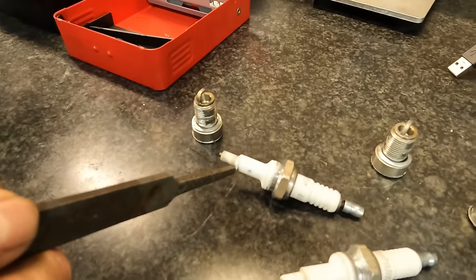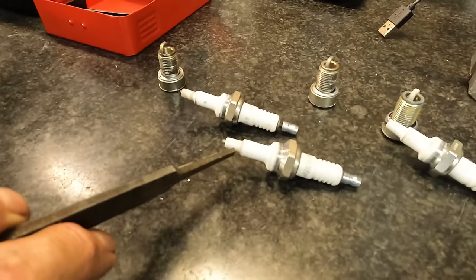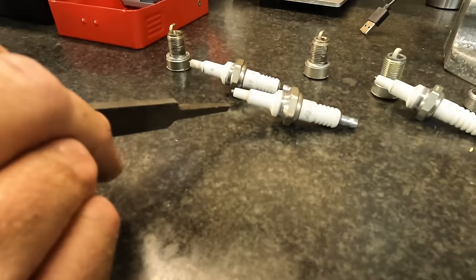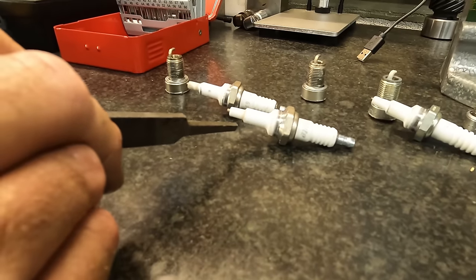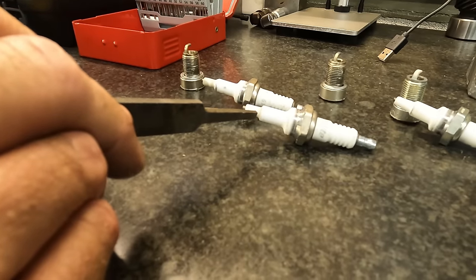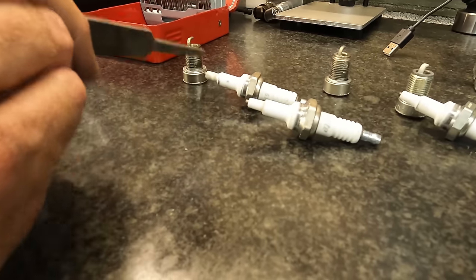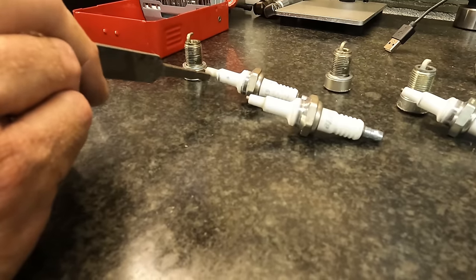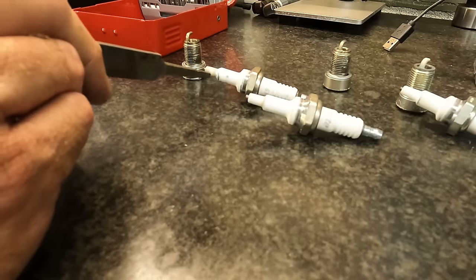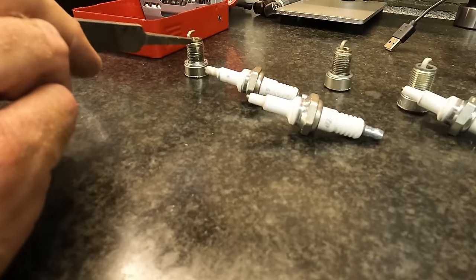And like I say, I like to see, from this ledge right here, it just depends on what the motor likes, 1/8 inch to 3/16, give or take. Usually in that window is where it wants to be. And this one is about right there. It's about 150 down to the bottom of it. And the heat still looks good.